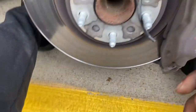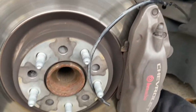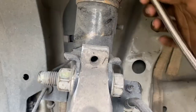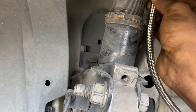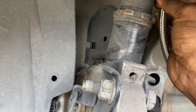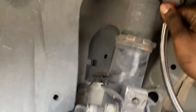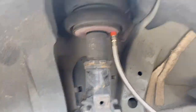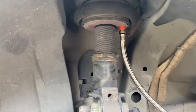Got the new airline connected to the adapter for the airline that runs to the tank. About to go ahead and install this into the bag. You literally just screw it in. It's kind of hard to do with one hand, but it's just like that — you get it started and then you should be good. I'm going to tighten that down a little bit, then connect the airline and start the car up. Let the bag fill. Hopefully it holds the pressure.